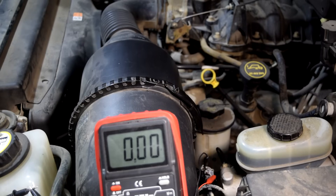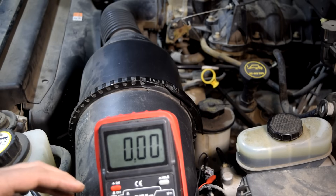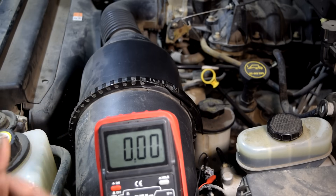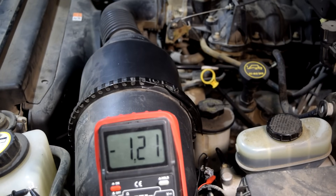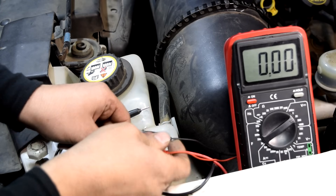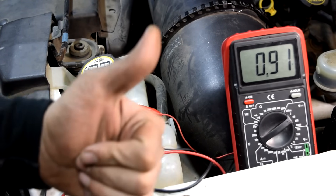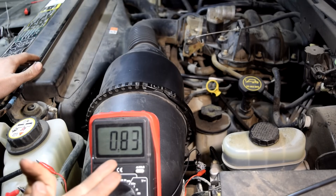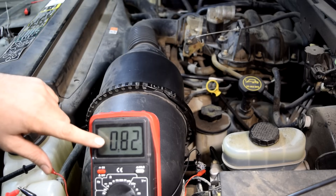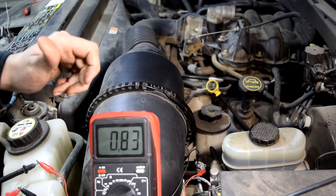At idle this car should have about one volt. I should mention the one-volt-at-idle reading is for this 2001 F-150 with a 4.2 liter when the engine is properly warmed up. I'm doing this on a cold start, so RPM is going to be a little bit higher and our reading will be higher than one volt. But if it's a good MAF sensor, it'll come down and gradually settle around one volt. After a couple of minutes, it settled around 0.85 to 0.9 volts, which is about right. Now I'm going to play with the throttle plate — slowly opening it, we should see a gradual increase in the voltage from our MAF sensor, and then on the way down a gradual decrease.